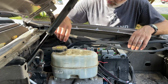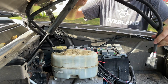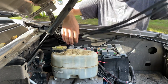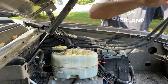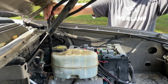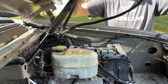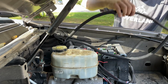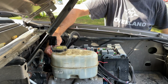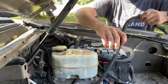accessories to it. To clean things up a little bit further, we took our solar wire, or our solar input, and our battery cable for the Goal Zero that were coming in one harness before, and separated the cables. So now I have two sets of wires going into one harness with the adhesive heat shrink. So now this makes one nice long harness here. This one can get coiled up over here and our solar can plug into it. And then this one here is going to run across the firewall all the way over to the battery into a breaker.